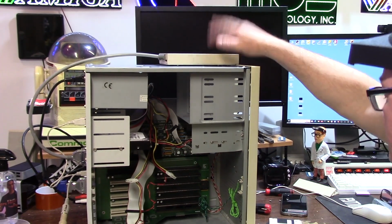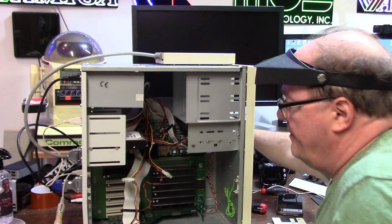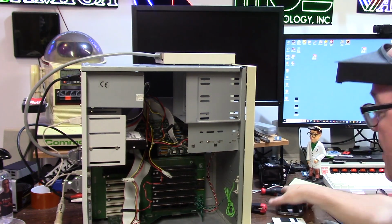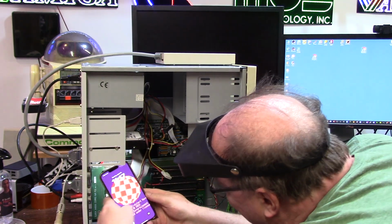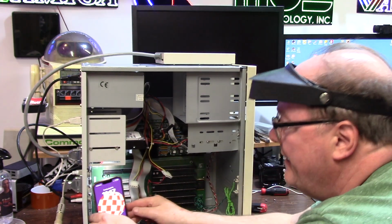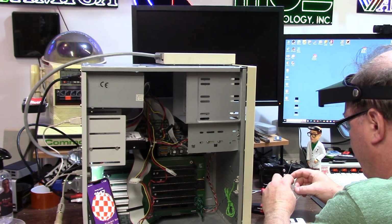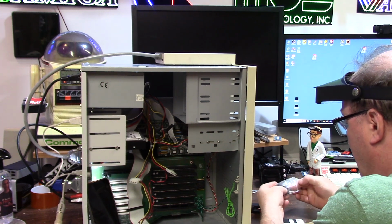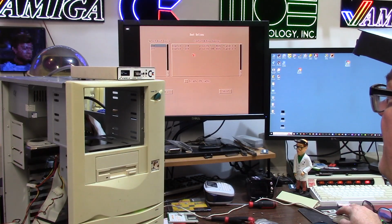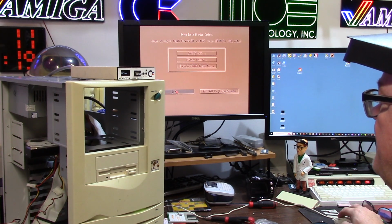I didn't feel like it. Hooked up the external Gotek and forgot that I have to put a jumper all the way in the back on the DF1 is 880 on J351. If you don't, your high density will just be DF0 and you'll never have a DF1 because it doesn't know and it's dumb. Boot options, yeah, DF1. Use that please. Boot.